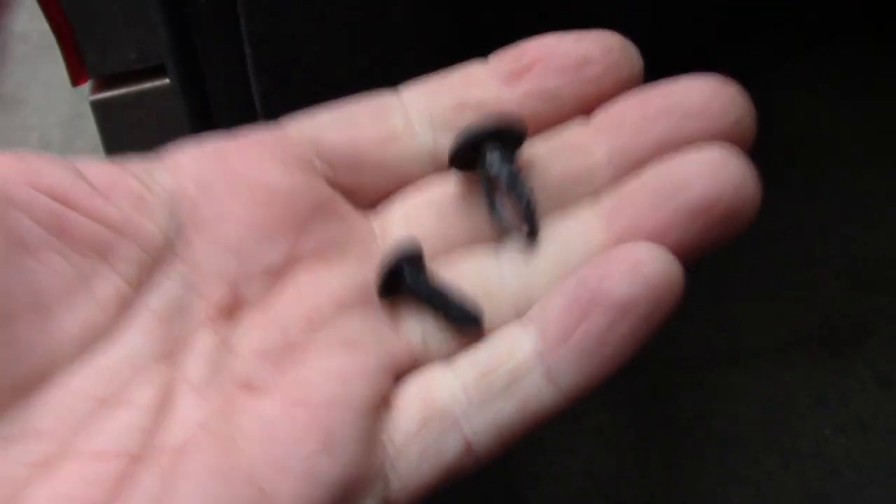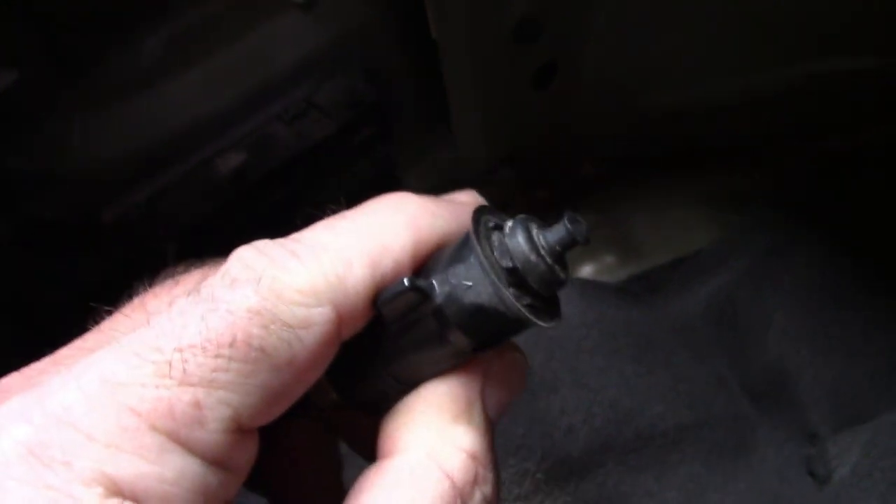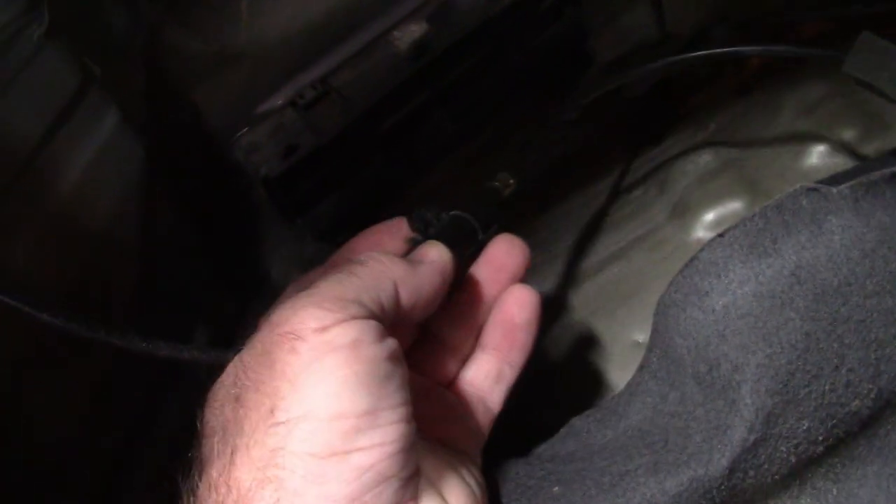There are some plastic clips like this right here. I've already unscrewed this clip — you can just take a screwdriver and twist it out and set it aside somewhere you won't lose it. There was another one up here, so this will just fold out of the way. Now you expose the cable where it runs beside the inner wheelhouse and goes up to the gas door. If I just take this and turn it clockwise, it comes right out — it just has a couple of tabs. Get it in that opening, turn it, and you're done. The rest of the cable has little clips holding it in place; I've already taken most of those loose. You can see it follows up the hinge.